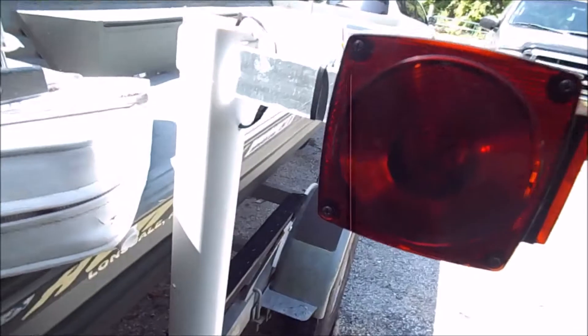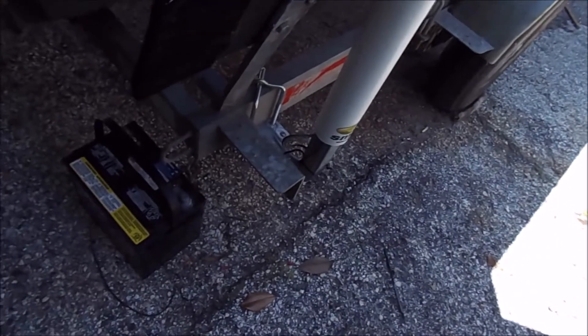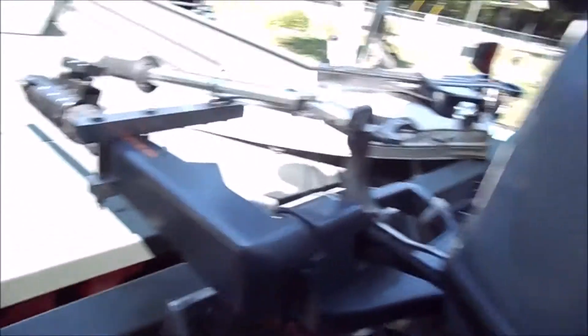I've had to add a ground to these lights — I moved them up to the top. I wasn't thinking, but the lights ground through that bracket down there where they're normally mounted. But I didn't want to dip these in salt water constantly, so I had to add a ground wire — no big deal.